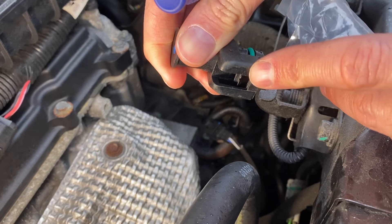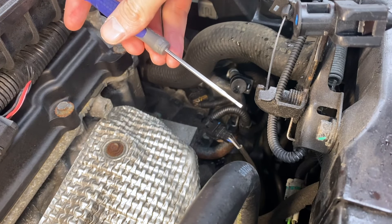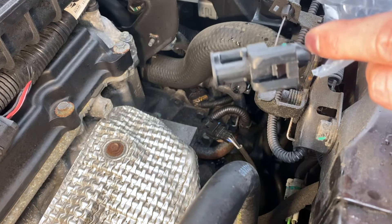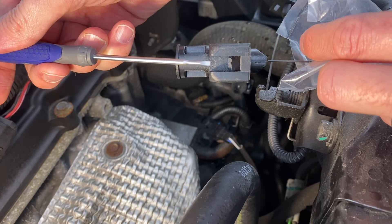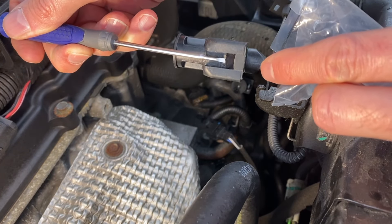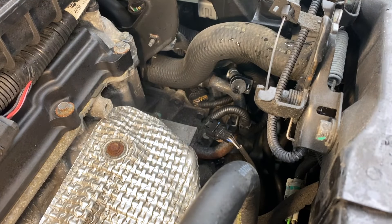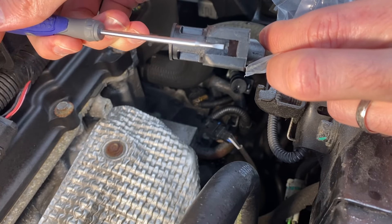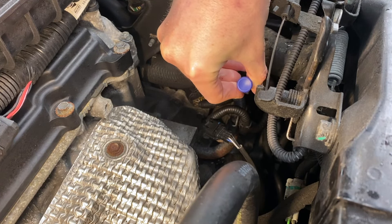The answer lies within — you'll see there's this little forked bit. Taking our very small flathead screwdriver — a type zero or type one, very tiny and narrow — we're going to insert it along the inside of the metal connection and push it inward towards the dipstick or the cap. That's what frees up this insert and allows us to pull it off. We're focusing the flathead to come in here, pushing inside on the inside of that piece of metal, pushing down and pushing in.